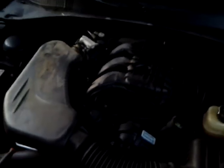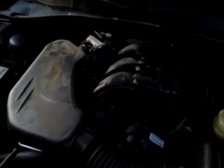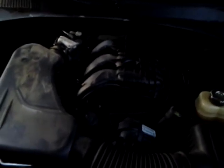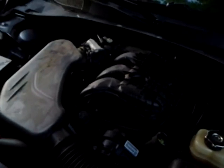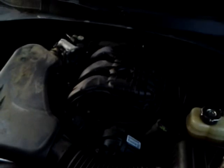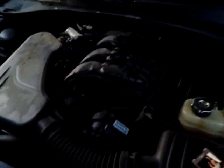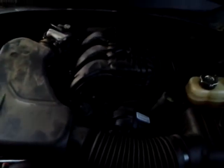But anyway, I mentioned earlier about just loosening brackets instead of pulling them all the way off. It worked great going back on. This thing fell right back together. I'm a believer in don't take off stuff if you don't have to. Maybe you'll loosen something to make something else happen. So that's what I did. All those lower brackets, the nut stayed on, and I loosened them up to get to what I needed. Best part is I didn't break anything, didn't lose anything.